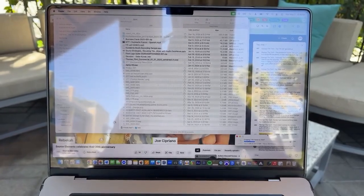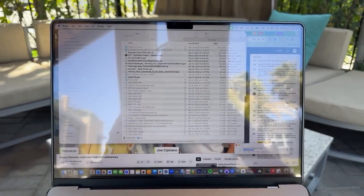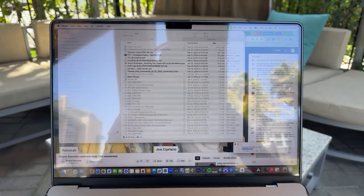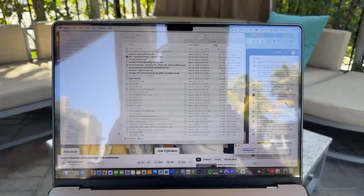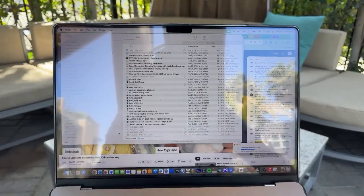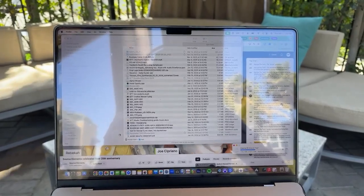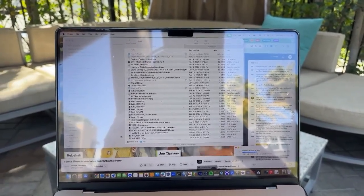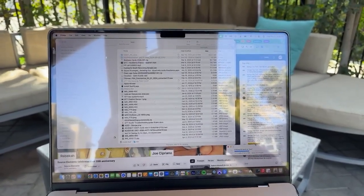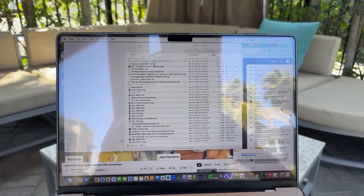It says about 35 minutes to go. Now we're at 45 minutes, now 46 minutes — that is not good. It basically copied and wrote files very rapidly until it hit about 120 megabytes, then came to a screeching halt. Now it has resumed writing — it says 50 minutes, and now that number is falling again, about one minute per second: 47, 46, 45 minutes. The write speed on these cards is mediocre or very poor. Compared to a USB-C 3.1 flash drive and definitely compared to internal drives, the read-write speed of these cards is quite slow.